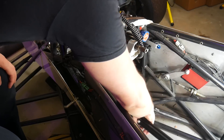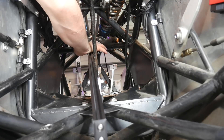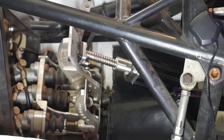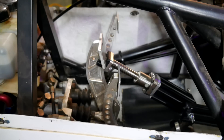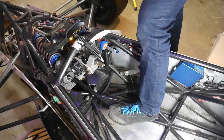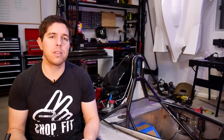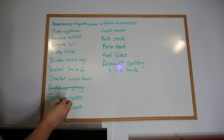This is all great in theory, but we need to prove it works in practice as well. Once the anchor is hooked into place, there's just enough room and visibility to look down from the cockpit and hook the other end onto the bottom of the brake pedal. You can kneel down and use your hands, but I think the simplest way is to reach in and step on the top of the closest arm. It extends outwards, presses in the pedal, and then goes past the center point, locking into position. The travel is of course adjustable with the ball screw, and as I've currently got it set, it pushes the pedal in plenty to torque up the nuts. The wheel feels like it wants to rotate just a little bit, but in the end 350 newton metres is achieved. When done, I can just push down on the other side of the lever and everything unlatches. I might need to cut this end a little shorter once the seat is poured, but that's an easy modification. After a highly iterative design process, I finally have a solution that works. The list got a little bit longer recently, so it's really nice to cross off two items — and a third item, bleeding the brakes, I'll be able to do by myself thanks to this as well.